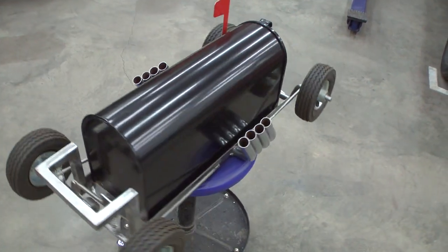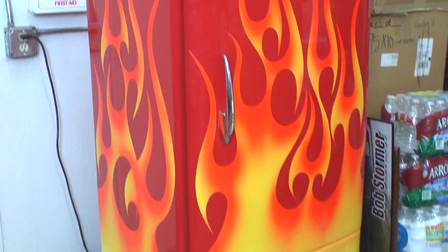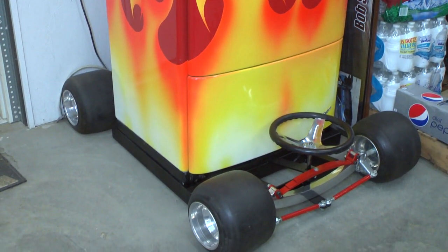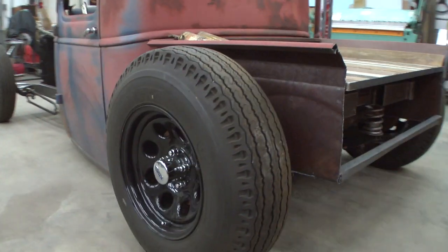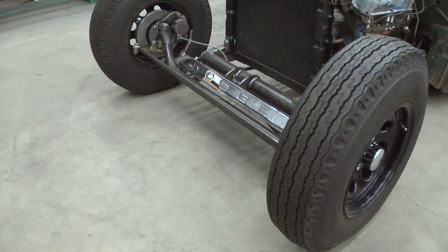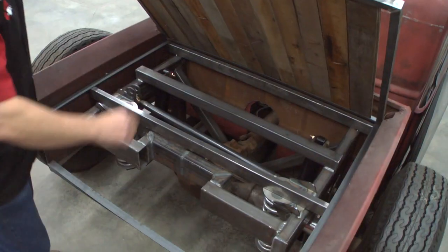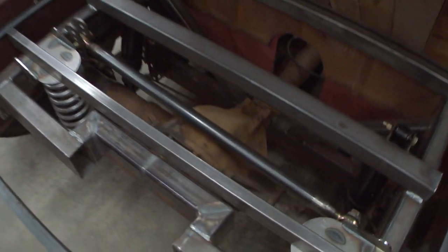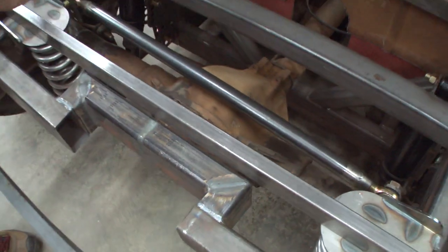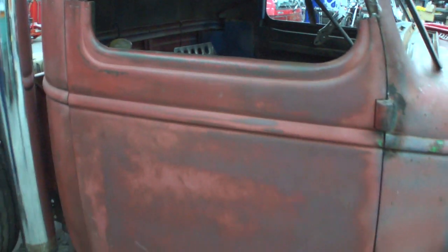Check the zoomies on the mailbox — looks like I've got mail. Over to my refrigerator, and we just powder coated this axle — look at the shine on it. That turned out a lot better than I thought it was going to. I've been working on the one you see behind me — this is a 41 Chevy with a 360 Dodge motor. We did a six-inch chop, a four-inch channel in the body, and installed a six-inch drop axle up front from Speedway. Out back there's a four-link with a massive panhard bar. Got the door handles shaved on the passenger side. I've been working on the patina and I think it's coming along pretty good.